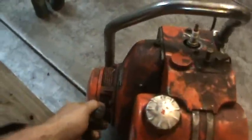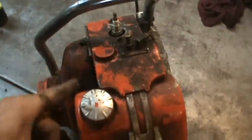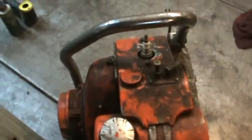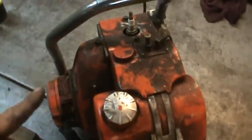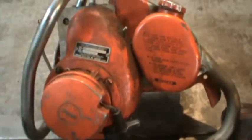So, the pull start's locked up. Possibly it's in the pull start, but I have a feeling, I think the crank uses roller bearings on this. If that's the case, this motor might be pooched. But if it's not, two of those together might make something pretty cool. And I believe they're 4 horsepower each, 77 cc's also. So the pair of them would make a nice 8 horse, 154 cc bike of terror.